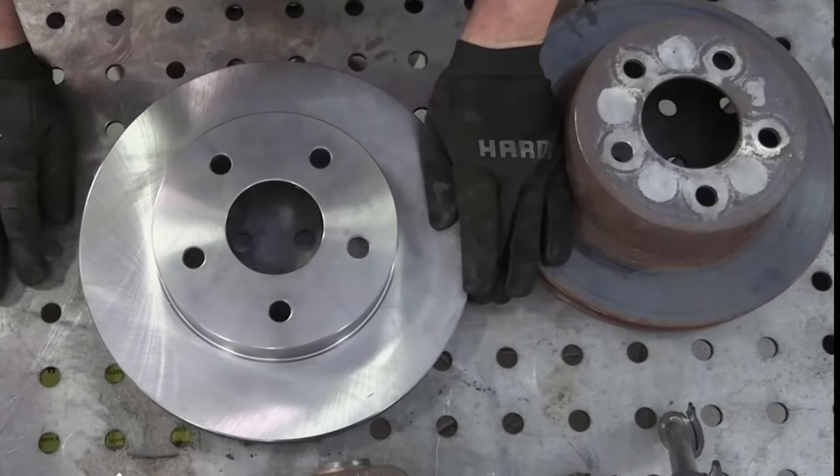That's how you upgrade your front brakes — the Ford Explorer Sport Track brakes use 12-inch rotors, they're a lot bigger, they'll help you stop, and it's a direct bolt-on. If you're running big tires you might as well do it. If you do the upgrade, I recommend writing everything down and keeping it in your glove box, because if you sell the Jeep this stuff slips your mind. I bought a Honda Civic once that had a brake swap done from an Integra and I wasn't told — I had to figure it all out on my own. So write that stuff down and put it in a folder in your glove box.